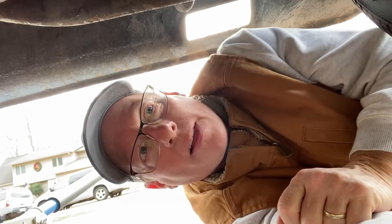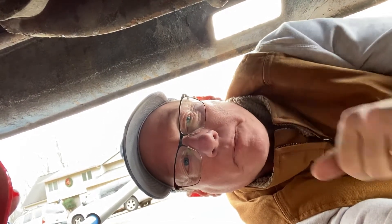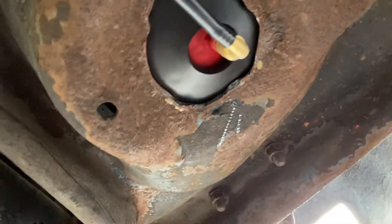The bags were installed and everything went well, except the G20 vans have a smaller hole where these bags are to go in. The kits came with four zip ties and I used eight — we had four hands on this bag, squeezed it until there was nothing left to squeeze, zip-tied them all up, and I even duct-taped the middle of it, but these bags would not go in the hole. They would go halfway up, and then there's a seam where the two components are fused together that creates a little eighth-inch ledge around it and it just wouldn't go. After two hours, I was done.